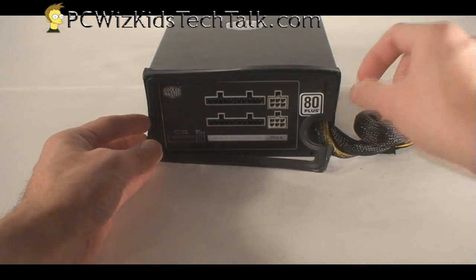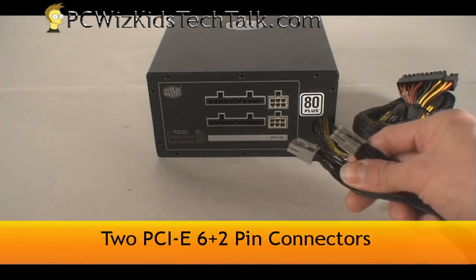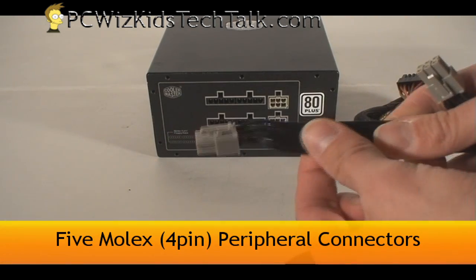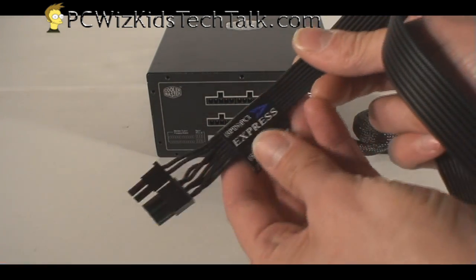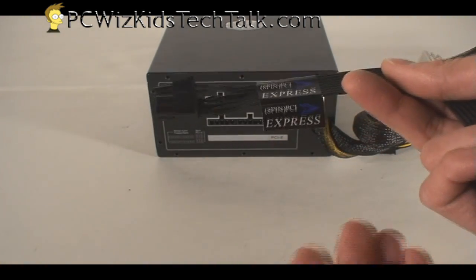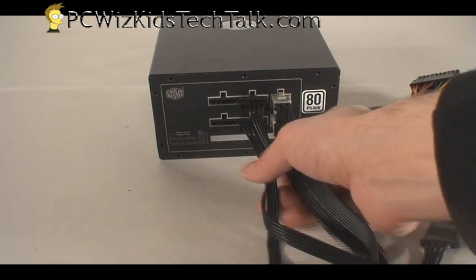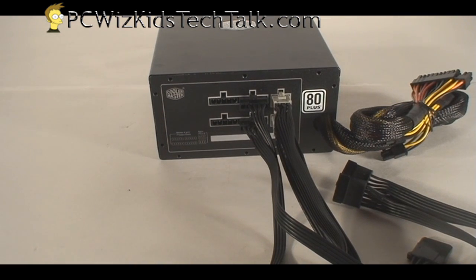Let's prepare this for installation. You put the silicone pads tightly along the edges at the back and on either side. Figure out which cables you need — do you need PCI Express, SATA, IDE? Look through the cables and decide. You can see there are 5 Molex, 9 SATA connectors, a floppy connector, and PCI Express cables — plenty, and they're all labeled, so you can't go wrong. Because they're all flat cable design, you're barely going to notice them going through your case — they're so thin, they'll keep the mess inside your case down to a minimum.